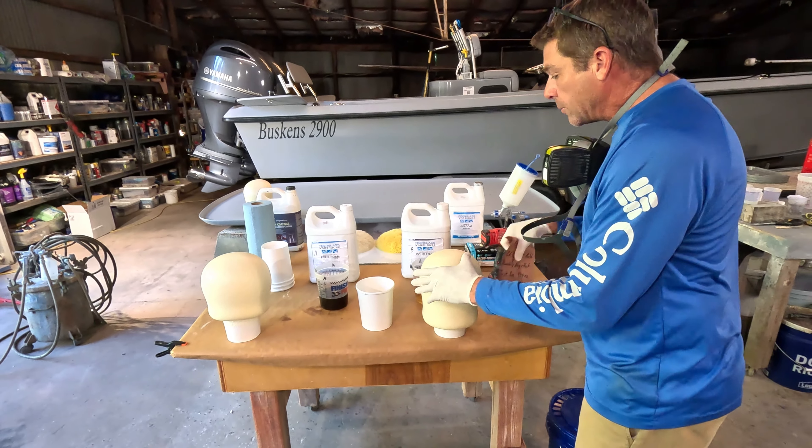Now we're going to see what this thing does when it has a runaway. Check this out — we've got substantial lift. Still got a little bit of a void right up in that corner. That's one of the tricky things if you put a floor down first and then drill holes: obviously you do not have clear containers and you can't see where you've missed. Sometimes you just have to drill prospect holes and fill in the voids. Whereas if you pour the material between the stringers and then trim it flush and seal it with some resin, you know for a fact that you've gotten everything.